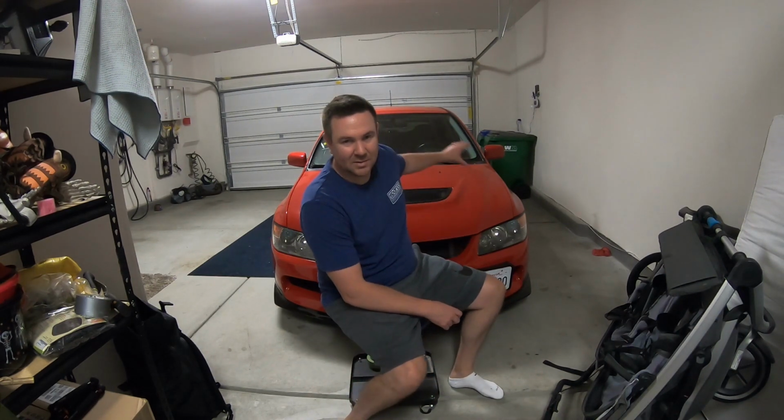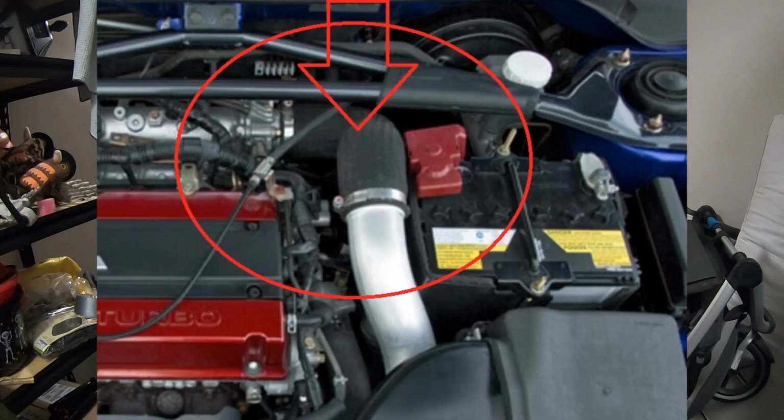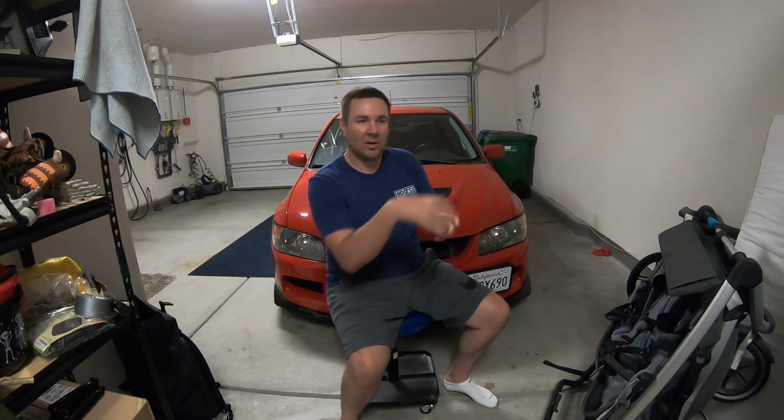And it's going to fix my major problem that I have right now, which is the charge pipe heading from the cold side of the intercooler that goes up to the throttle body is just getting shot right off. I think the rubber hosing from the factory, it's like a 90 degree elbow, is just worn out, and the previous owner has been running 25 pounds of boost for I don't know how many years. So I think it's just wear and tear and needs something a little bit stronger.